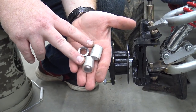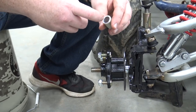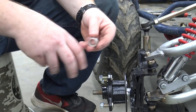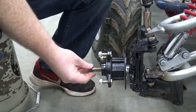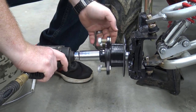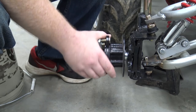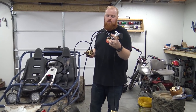The kit comes with two long spacers and two short spacers. The short ones would have been perfect behind the hub, but I would have had to bore them out — they're not quite 5/8 bore, so they were unusable. What I did was go down to Ace Hardware and buy two one-inch 5/8 spacers. Then these small spacers will go on the outside of the hub for the washer and nut to ride against. I like mine a little stiff — not so much that they don't free spin, because they will break in over time.